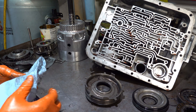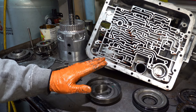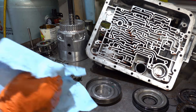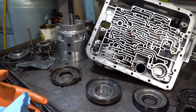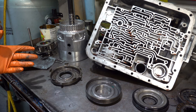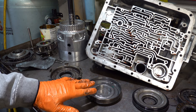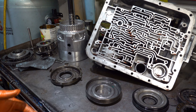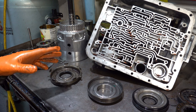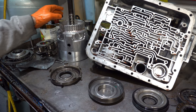But like I said, unless you take the time to clean this up completely, reinstall it, assemble the drum with everything clean and new parts, and then do your air check, you won't know definitively. I may do that depending upon what kind of time I have. But if you see forward clutch burn up like this, the default posture should be just to replace this, along with obviously this, because chances are it's this, especially if you can't find anything here on the sealing ring surface.